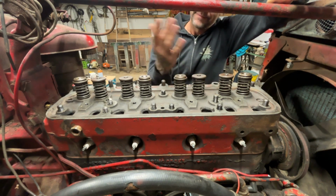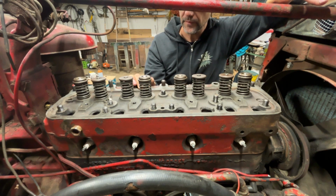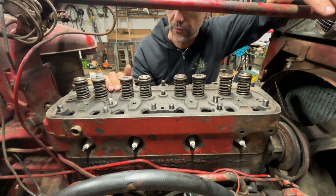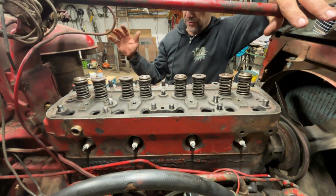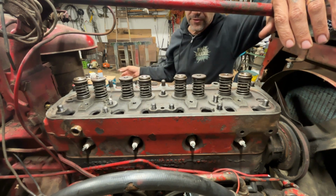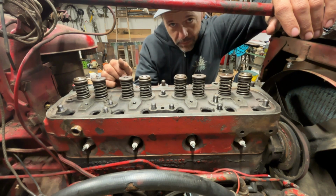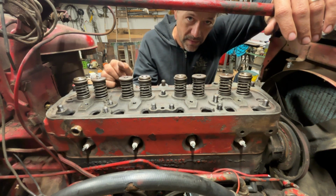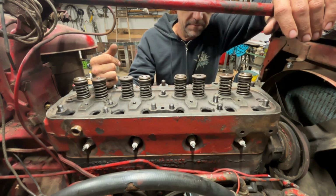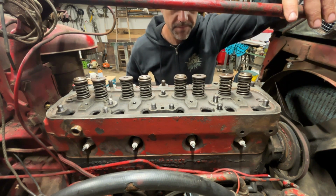So it is what it is. I'm just going to put it in once the head's on there like it is now. That's where we're at. I'm going to start putting the nuts on the head studs and torque it down. In the meantime, I still have to get the manifold on, which has to happen after this is torqued down. The oil pan's over there. It is a filthy mess, and I've got to clean that up. I want to prime the oil pump, which I do by stuffing Vaseline in it so that when it starts up, it's immediately sucking oil. We're in the home stretch now, putting this thing back together. The head looks awkwardly cleaner than the rest of the motor. We're doing good, so let me get back to work.